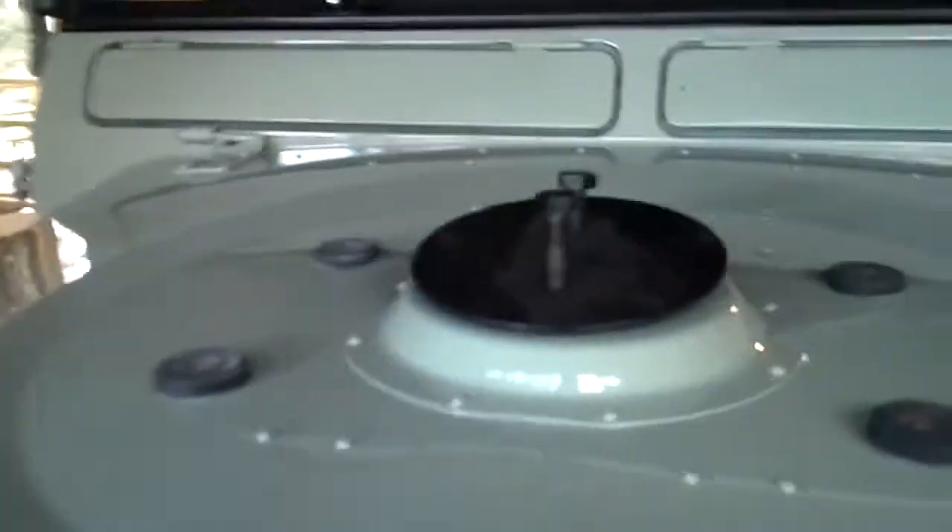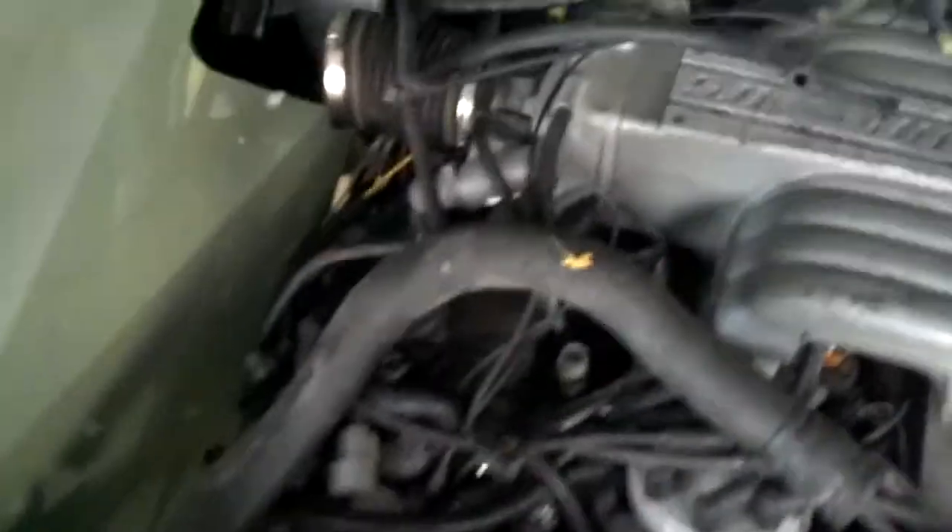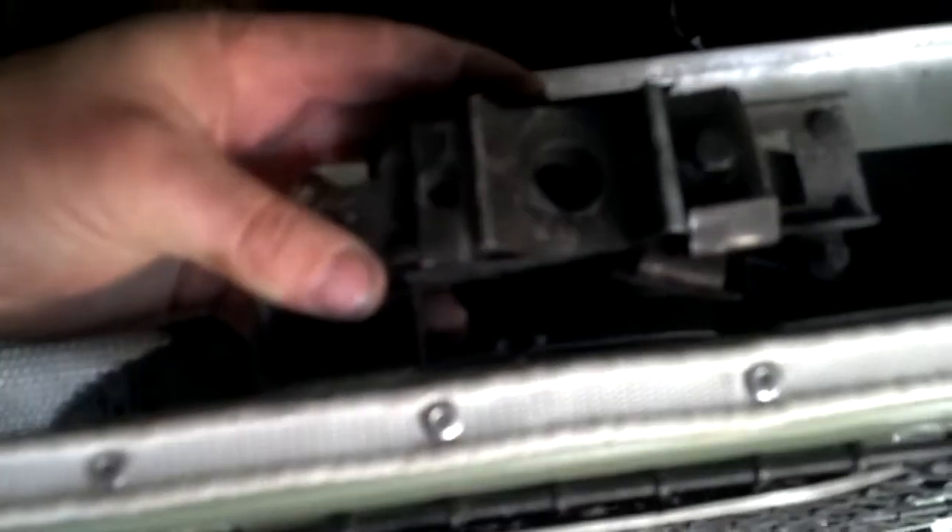Clearance up top — we made this the same elevation as the bead here so I can bring a plate across and weld straight across for an attachment bracket. The gap here makes me curious: the Discovery hood release, once I do away with the original linkage, I could actually mount it in here and get my hood release back in. Right now it looks like if I fabricate a plate there, I'll have that as an option to consider.